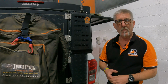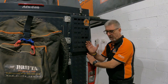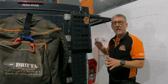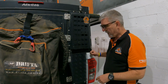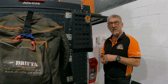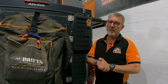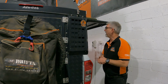And also the mounting brackets that hold this Canopy camper from here to here, you need to check them as well, because the Canopy camper's trying to pivot like this, or backwards and forwards. Also check, because all this is held on by 4 or 6 bolts from this tub to that chassis. So it's important to make sure things are tight. Corrugations do hurt. A couple of 100,000 Ks of corrugations, your car's finished, it's done, it's all over. Everything is broken on it. Anyway, we'll continue on this way.